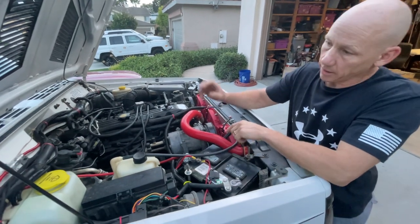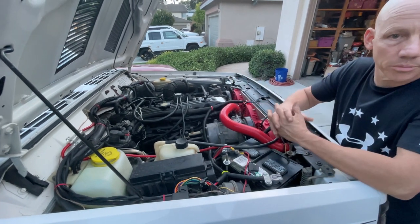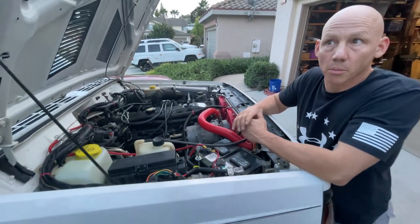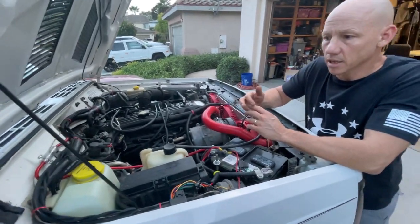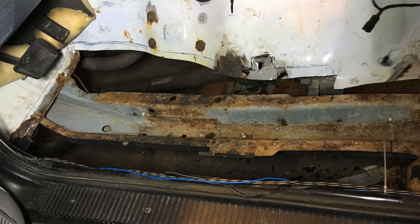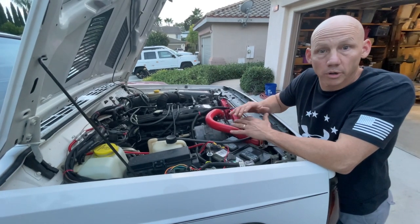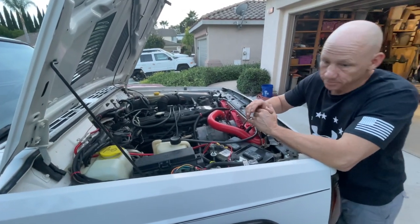Pretty much under here, other than the wiring for the fans, light bar, and radio system, those are all the modifications — plus a basic tune-up with plugs, wires, cap, and rotor when we first got it. We got the vehicle in May of 2018 for about $1,500 — it was a rolling wreck. The floor pans had huge holes in them; Brandon welded new floor pans front and rear, and even patch-paneled the rear deck. We also did front wheel bearings and all-new brakes — calipers, rotors, and pads.